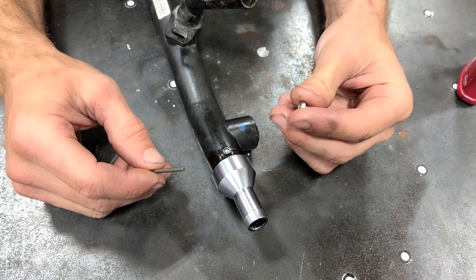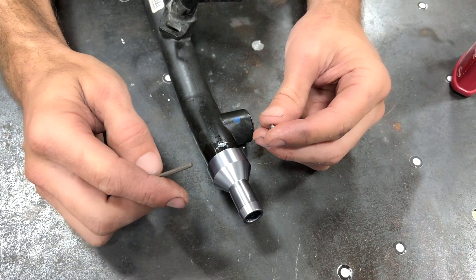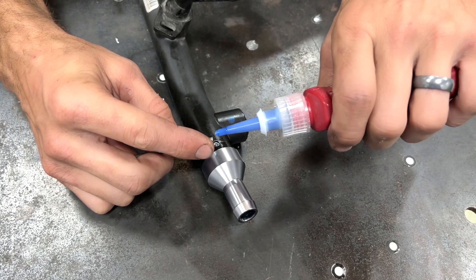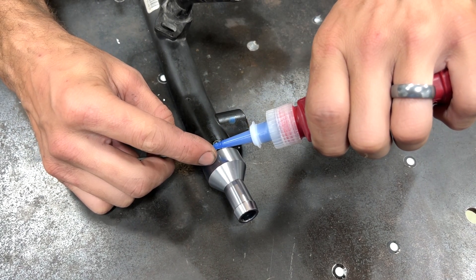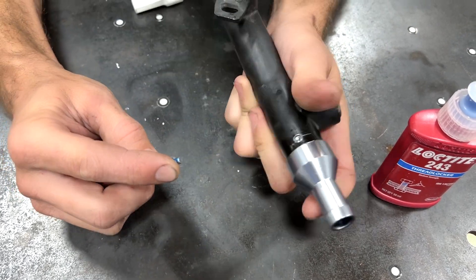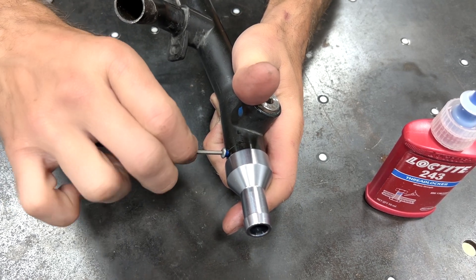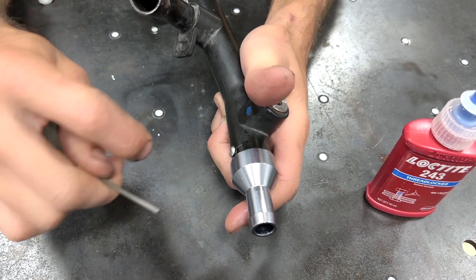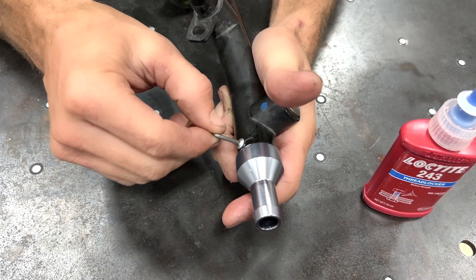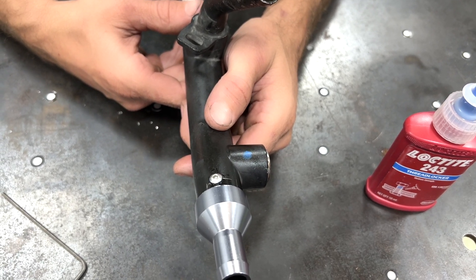I can make small adjustments to get the hole lined up and then go ahead and start screwing in. We have a little M4 button-head bolt that's going to secure our coolant adapter. Its only job is to keep the adapter from getting shoved out of the tube by coolant pressure — it's effectively a pin. We put a little Loctite on it because we're not cranking it down tight, just putting enough torque on it to activate the Loctite. And that's it — now we're ready to set this back in the truck and reassemble everything.